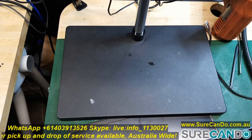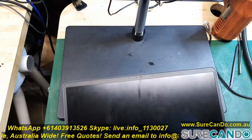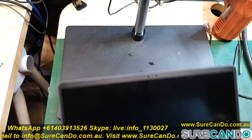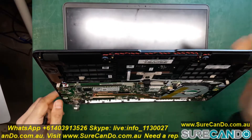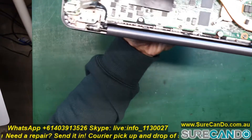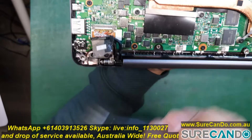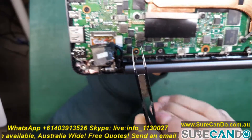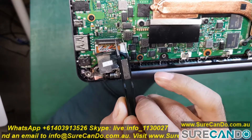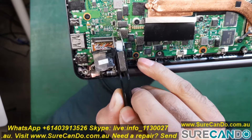Here is an ASUS UX430 model. While I was working on it, the backlight disappeared from the LCD. Upon further investigation, I found that the diode which controls the screen on signal from the lid closing on/off switch is faulty. It is not letting the 3.3 volts pass to the LVDS pin number 13. I found this small diode just next to the coil, which may have been damaged from excess heat when I was working on the capacitor.